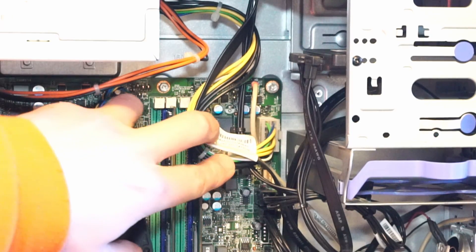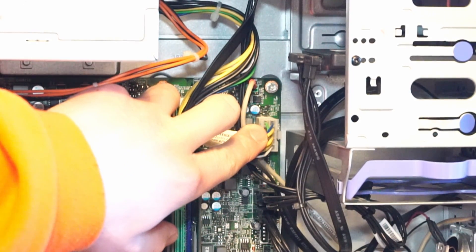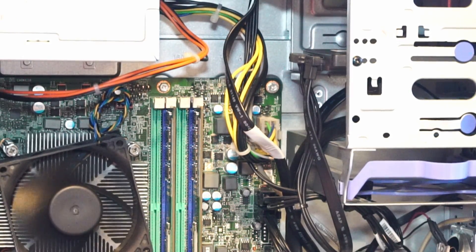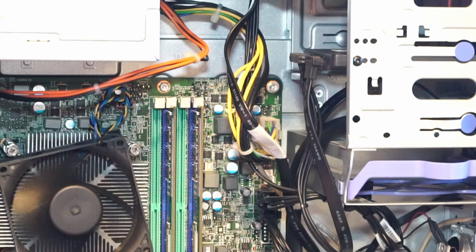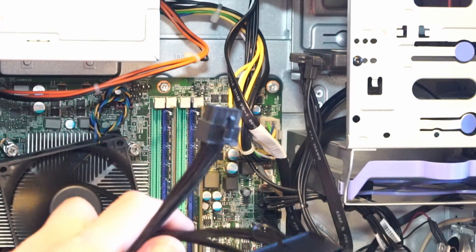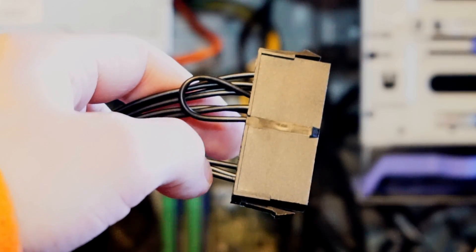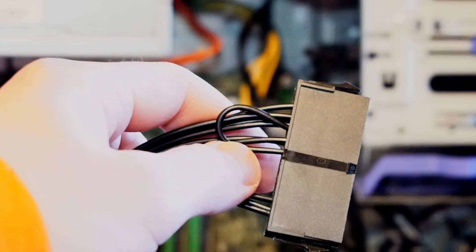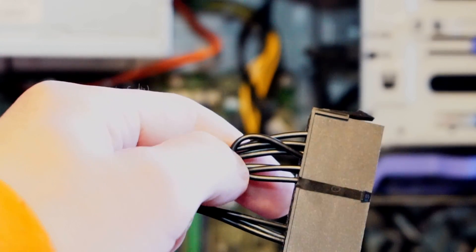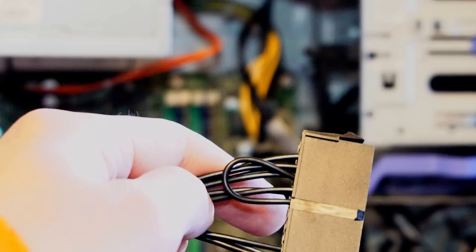Because this Lenovo motherboard has a tiny little 10-wire pin-out for the power supply connection, if you want to install a full-size ATX power supply so you can power a larger graphics card, you'll need a cable adapter that looks like this — a 24-pin to 10-pin adapter. One downside is that this cable will essentially act like a jumper, just like a jumper that you'd use to test the power supply with a paper clip.